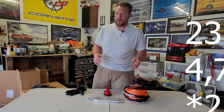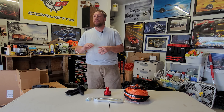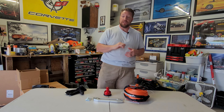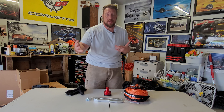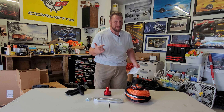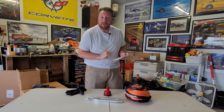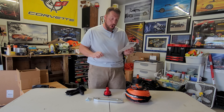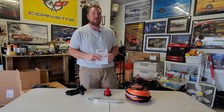Effectively you're operating with two cables, so the load and all the shock is divided evenly along two sections of rope. In the case of this synthetic rope, we go from a working load limit of around 3,800 pounds up to 7,600 pounds — a huge difference. Even with a steel cable you go from 2,000 pounds up to 4,000 pounds working load limit, which is still less than the vehicle weight but a whole lot better. The instruction sheet for this rope actually says: use a pulley block for all loads over half of the rated winch capacity. So even the instructions tell you — get a snatch block and use it.